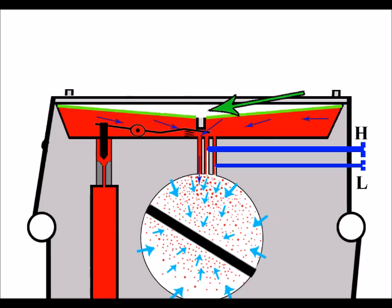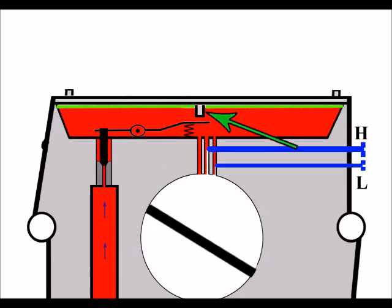That's because when the engine's running and the diaphragms come down to allow fuel to come out, we need that plunger to travel down just enough in order to push down on the back of that metering lever just enough so that it tilts that lever up just enough in order to open up that needle valve at the front there just enough for the correct flow of fuel to go in to the top there in the metering area, which in turn then allows the fuel to be available there in the inlet for the engine to use, because we've got plenty there coming down the main jet and there into the venturi. So that was under normal working conditions, but let's have a look at the other scenario then, if we've got a plunger that's too short.